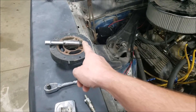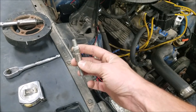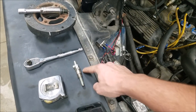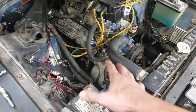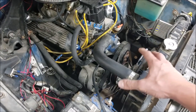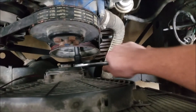I have spark plug number one out on the Maverick engine and we've installed our piston stop on spark plug hole number one. These are piston stops I made myself, but you can pick them up for sub ten dollars — I'll leave the link below. On a Ford, about an inch and an eighth protruding from the bottom of the spark plug seems to work well. Basically, we're going to roll the engine over by hand until the piston contacts the stop, make a mark on the balancer, then rotate the engine backwards and make another mark. You do want to roll the engine over by hand — I've heard stories of people cranking it with the starter until the engine stops, and obviously that gives you some pretty catastrophic results.